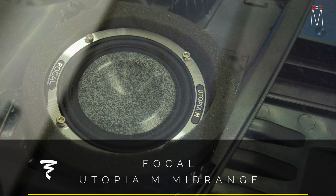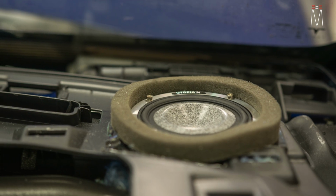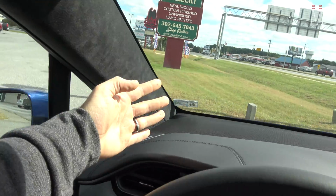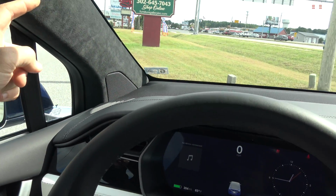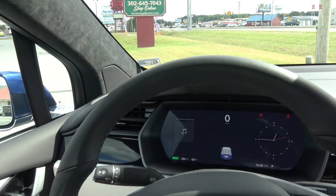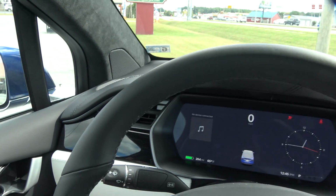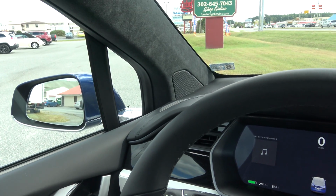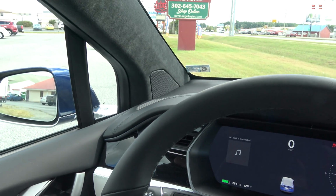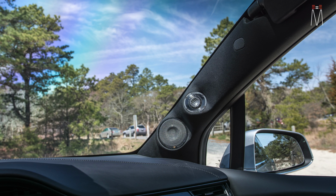I've done a lot of cars. It still stages well. The biggest downfall is going to be the width. Your width is going to get a little bit narrower when you're playing into the glass versus if you do have these speakers on axis right here. The good thing about the Tesla Model X, it has a very, very wide pillar, so you can actually do the speakers on axis and it still looks relatively factory and aesthetically appealing. I will link a video down in the description and also after this video of the same car that we did here, just with the speakers on axis in the pillar, so you can see what that looks like. So check out that video.